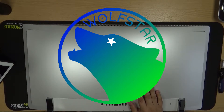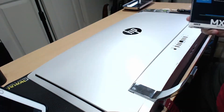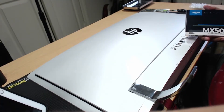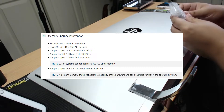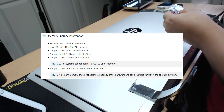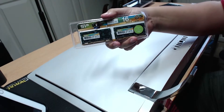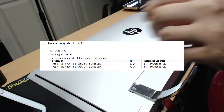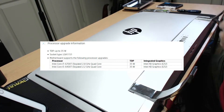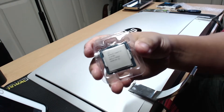Before installing the new parts, I had previously removed the old hard drive and RAM, but not the CPU. Timestamps are in the description if you're looking for something specific. I'm upgrading the 2.5-inch 5400 RPM hard drive to a Crucial MX500 500GB solid state drive. The SODIMM RAM sticks that came with the computer were two different sizes and two different brands that added up to 12GB of DDR3-1600, but I'm upgrading to 16GB of Silicon Power DDR3-1600 CL11 memory. The CPU is being upgraded from an i5-6400T to an i7-6700T, as that is the only CPU upgrade this PC supports.